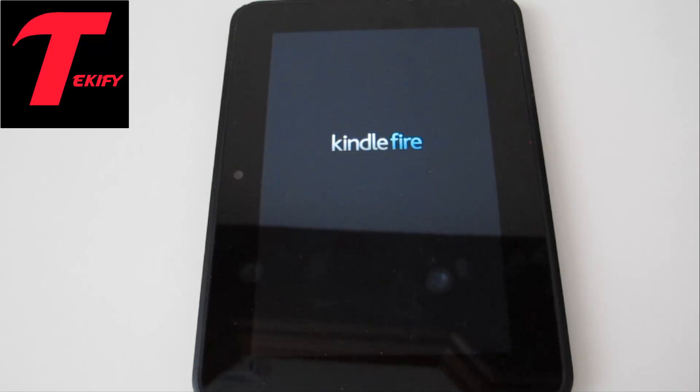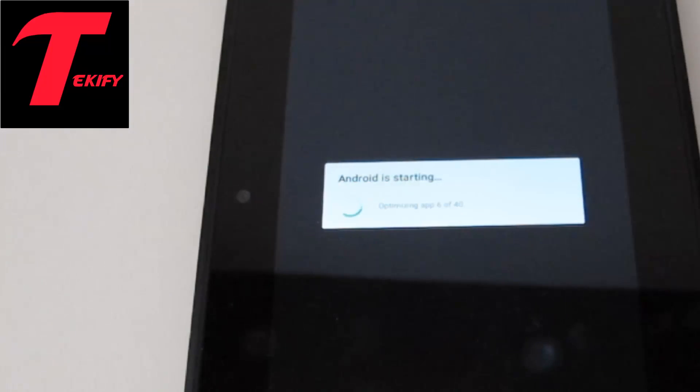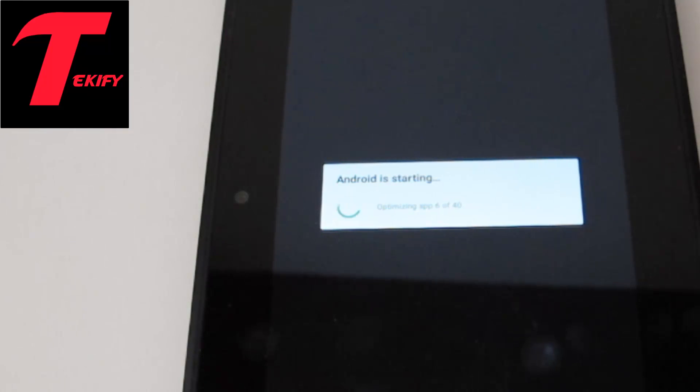ROMs can take a while to boot up for the first time. However, after about 5 minutes, just hold the power button until it goes off and try again, because it's quite possible it's got a boot loop — that can sometimes happen when you first install a ROM. Here's the cool Omni ROM boot animation. I did get stuck in the boot loop like I said and had to hold the power button. For some reason that happens to me every time I install a ROM, even if it's stock Kindle Fire.